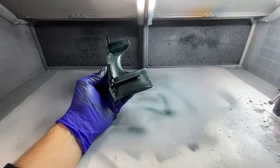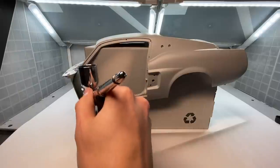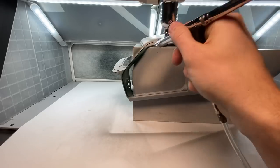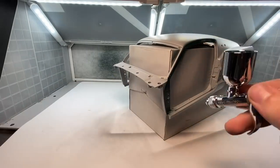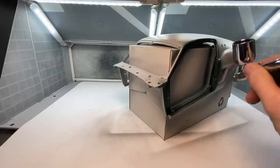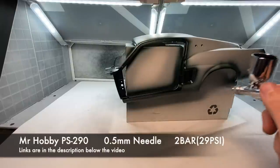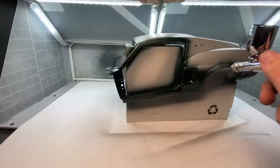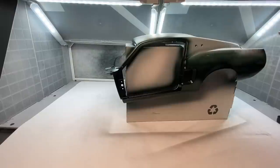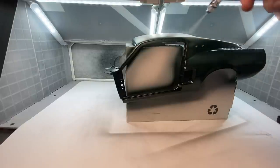Just for a bit of a timeline — the entire paint job took place over a couple of weeks, about a month in total, with a lot of time in between as various stages of paint needed to cure before moving on to the next one. For the main body itself, I painted the shuts and returns or inside pieces first since those are harder to cover later, making sure everything had a couple coats of paint with no primer showing through, and then moved on to the bigger areas like the rear quarter panel, the roof, and the rest of the body. With the first side completed the body was turned around and I moved on to the other side.